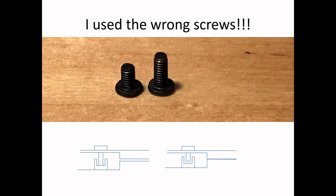Sunday night I stayed up till midnight, one or two in the morning. I took apart the GPUs again and removed all the long screws — I had used exclusively long screws on all of them. I put the short screws in and clearly that was the problem, because you could feel as you were tightening the screws how you were making contact and pressing the thermal paste between the water block and the GPU. When you turn and tighten the screw, it just had that feel that you were squishing the thermal paste and making a really good contact.